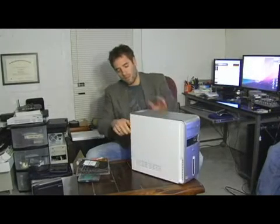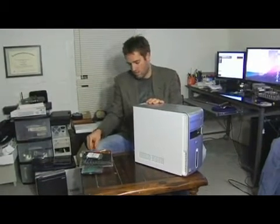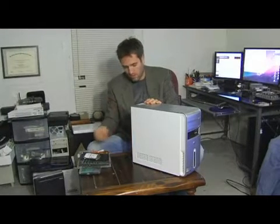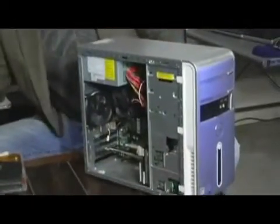It's always going to be the left side of the computer. You're going to remove the 2 screws out of the back and slide that panel off. I have little thumb screws in here. Some computers now will come with these. Makes it nice and easy for you to get in and out. You don't even need a screwdriver. But if you do, even this one, if it was too tight, you can use a screwdriver. Now, grasp, pull, and slide that out.